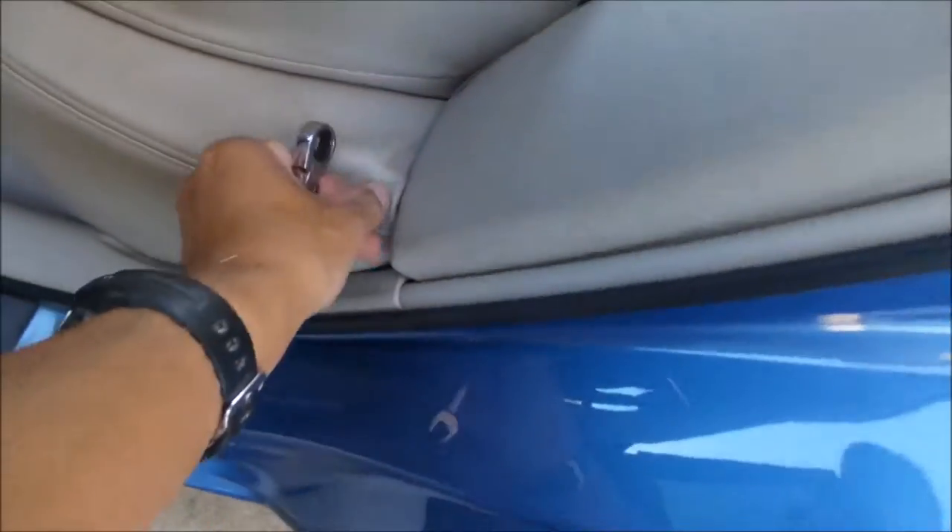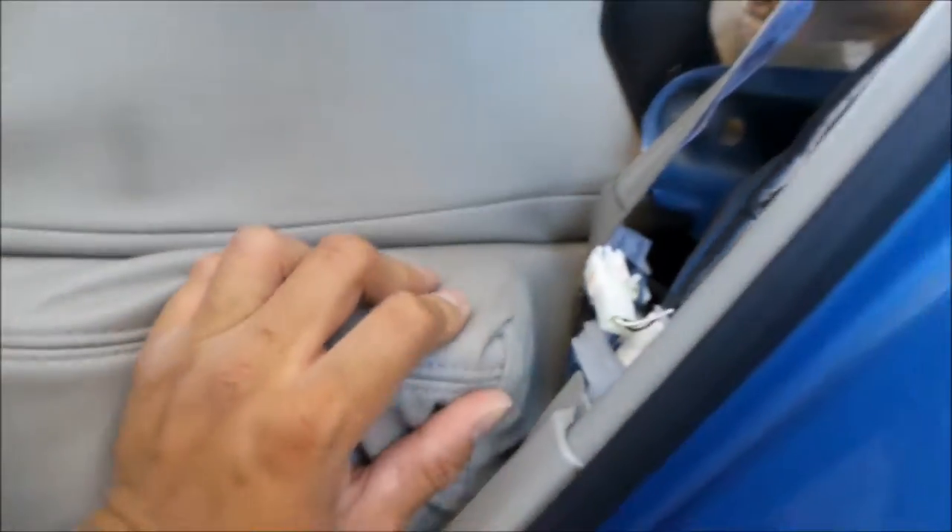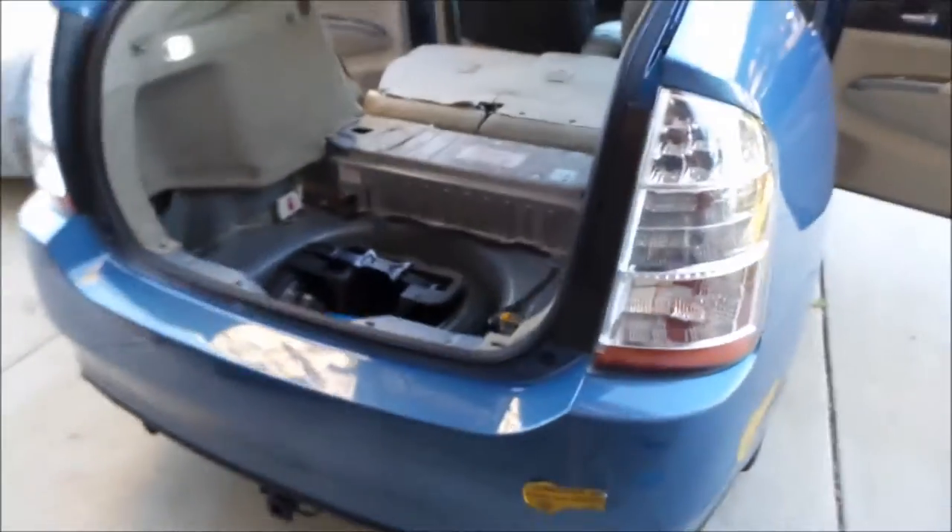It's like hiding down here, so you gotta take these bolts off — it'll be like this. This is gonna be really hard to do with one hand so I'm gonna put the camera down. So I got it out — you have to press the cushion in all the way so you can get to that, then it just comes right out. Maybe whoever worked on the shock absorbers on that car before didn't put that bolt back. So I'm assuming this side has one too — let's do the same thing on that side. Just press up on it and it comes right out, easy.